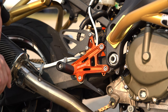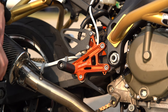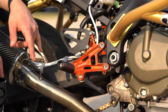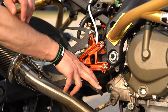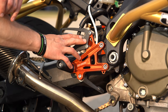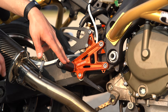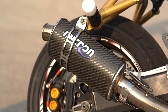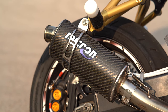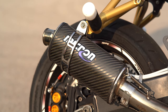For the rear sets I am running the SS Moto rear sets. I kept the heel guard on and this is an OEM foot brake lever but I powder coated them to try and match the frame as much as possible. I adjusted the foot brake lever down a little more so it has my foot at a better angle. OEM master but I just have an HEL stainless steel brake line for this foot brake. This is just a Micron exhaust — what came on the bike when I bought it. All I did was cut it down about 8 inches so it wasn't sticking out way past 12 o'clock and scraping everywhere.